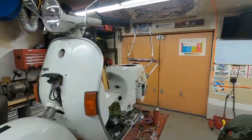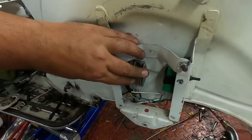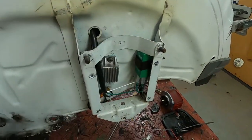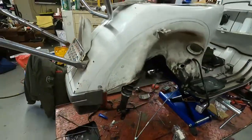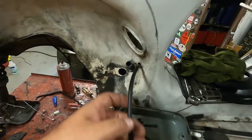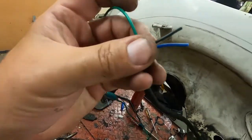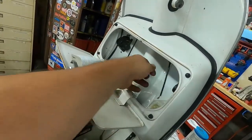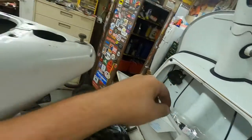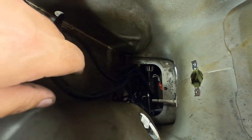All right. I've got the wiring harness all run through. We've got our BGM voltage regulator, AC turn flasher. Everything's all hooked up. Still have to run the wiring for the taillight. I got to get this plate off so I can pull it through the hole. Here's our engine side harness. And so your black and blue coming off the stator, our green kill wire. I've got our lines run inside the glove box for the 2 turn signals, and I've already connected the turn signals for the left and right side for the cowls. Ground is all set up.